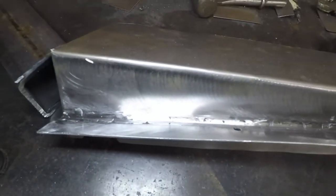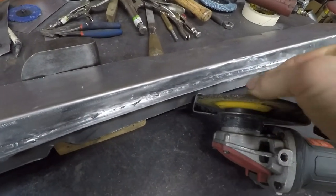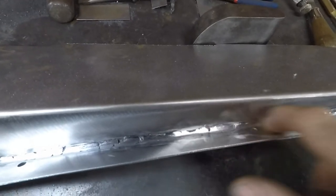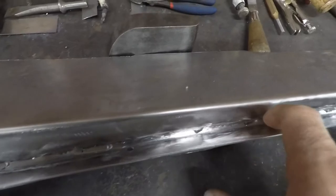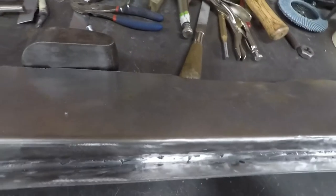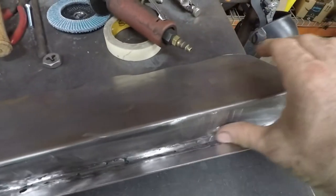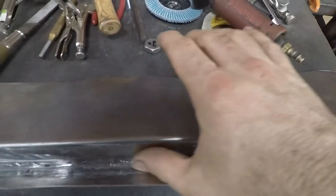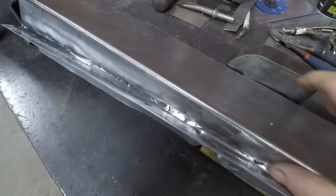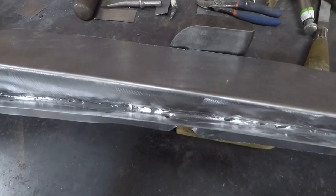That turned out quite nice. I did what Fitzy from Fitzy's Fabrication on YouTube says — used an old grinding wheel that gets radiused over, went into the corner, and ground up and down until I got a nice radius there. I'm not going to worry about all the little pits and stuff — this isn't outside of the car or structural. We'll just come back with a little body filler, fill that in, take some sandpaper and a dowel pin, and get that nice. That worked out really, really well. Highly recommend Fitzy's Fabrication on YouTube — an older body man who has a lot of experience and uses minimal tools.